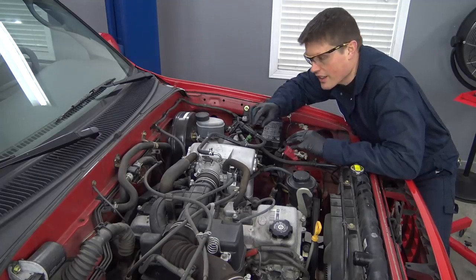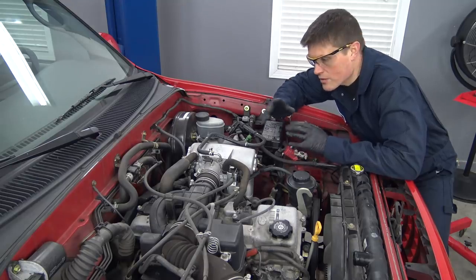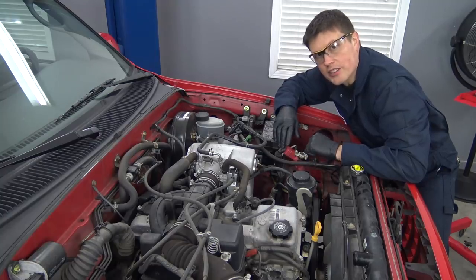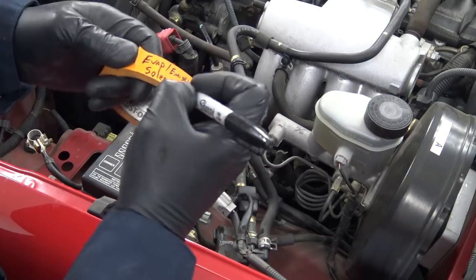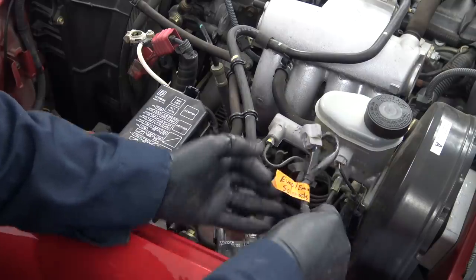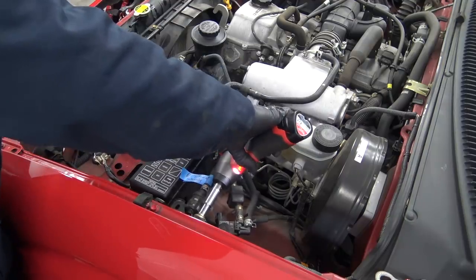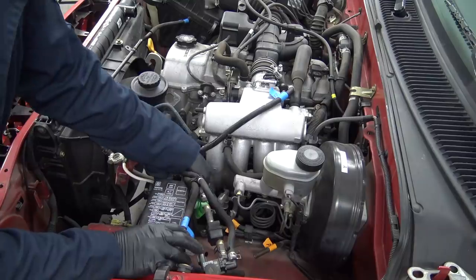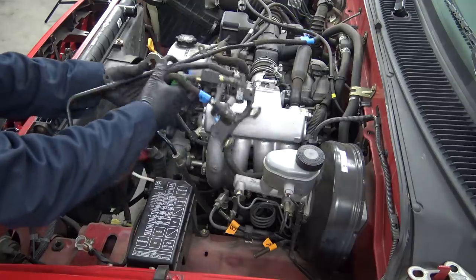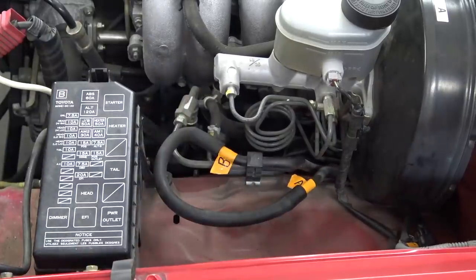I'm being really careful not to damage anything — lots of little clips, lots of hoses and things. It's hard to tell what we'll reuse when it comes time to do the engine swap. For whatever we don't use, I think I'll be able to sell, so I'm going to keep it all in as good a condition as possible. As I'm removing parts, I like to keep assemblies together and connected — it makes it easier in case you need to reuse or repurpose them later on. I also like to cap off any lines to prevent them from leaking or venting fumes, and it keeps junk from getting in there too.